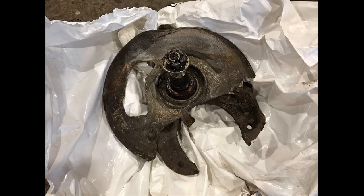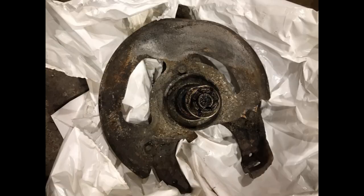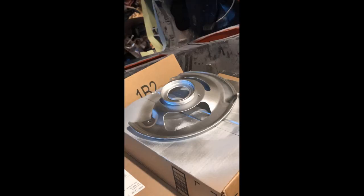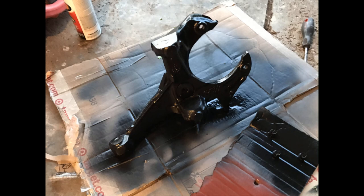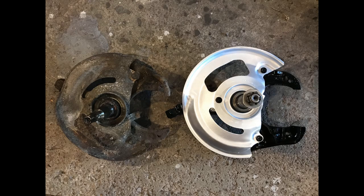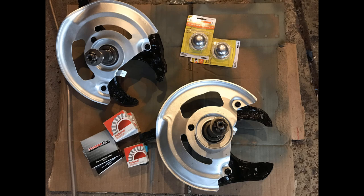Here are the spindles that we used on the car. My buddy Steve got me these and they're off of an S10. They were pretty grimy when I got them, but I worked to degrease them and get them clean. I tossed them in the blast cabinet, cleaned them up really good, then went to work to paint them, and they came out really great once they were all cleaned and painted. Here's a good before and after next to one another. A visit to O'Reilly got all the needed bearings, seals, and dust caps for them, and got them on the car — they bolted in pretty easily without any problems.